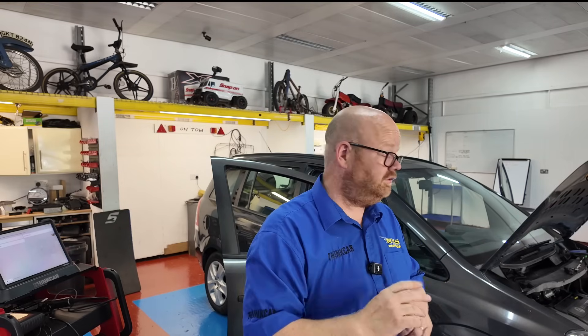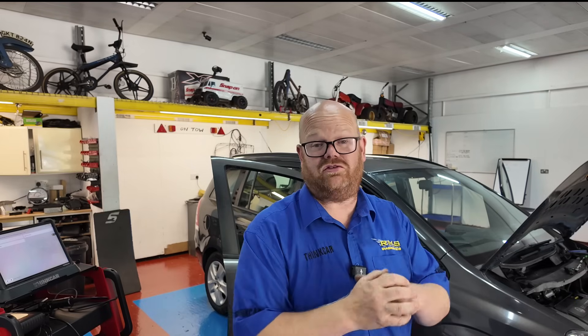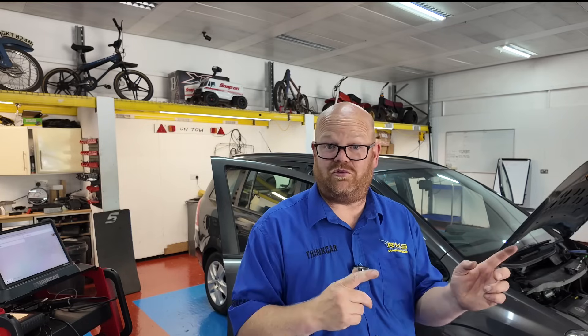So where did they go wrong? Were they wrong to send it away for testing? I've seen it since I've been in the trade - people suspect the ECU, send it away, and the results can go either way. This one said the ECU was kaput, get a new one - but the root fault was in the same place all along. It just goes to show: powers, grounds, load testing - this was a fairly basic one that should have been picked up. If you've been caught out like this, tell me your story in the comments. Like and subscribe, and check out the Instagram page - send me a direct message with your email address and I'll send you a PDF copy of our diagnostic checklist.